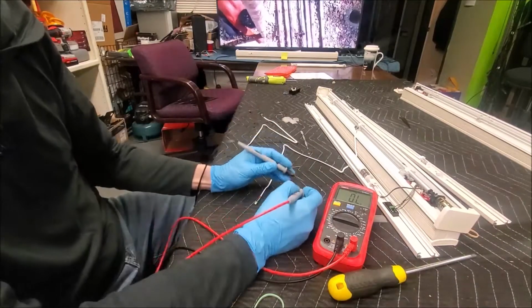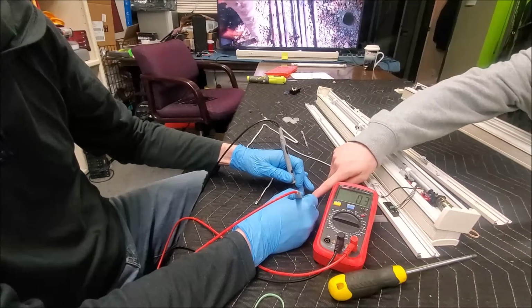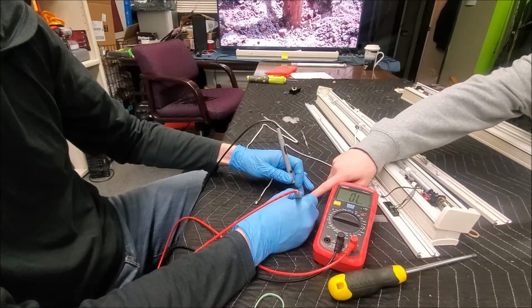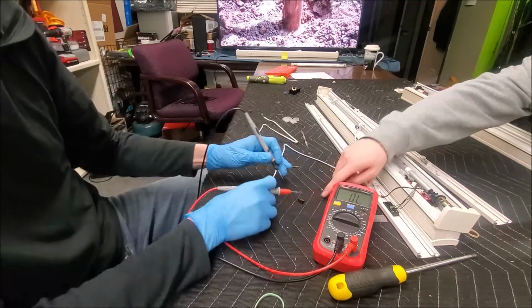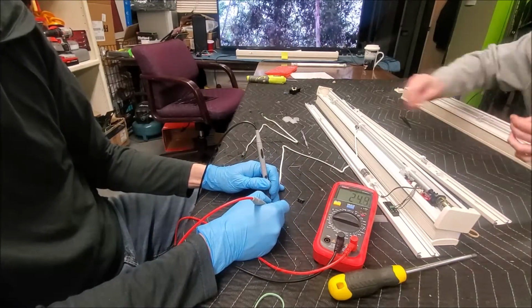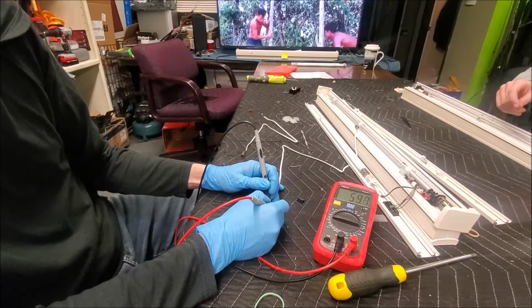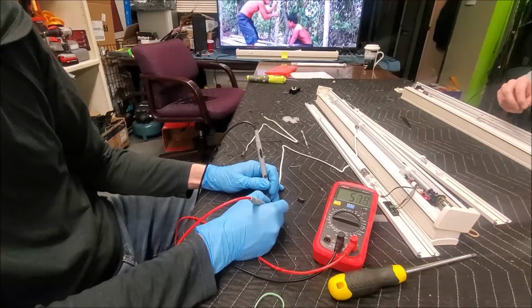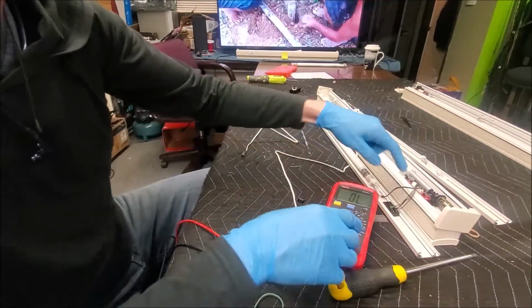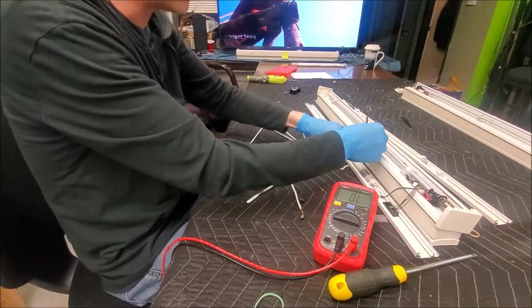And when we put it down, we get 0.3 and OL, and that is all it does. Now that one is healthy. If we look at this one, we get 24, 26, 62, 60. What is going on? Well, it's bad. That's what's going on. All right, now let's get that fixed, and then I'll show you how to fix the second part.